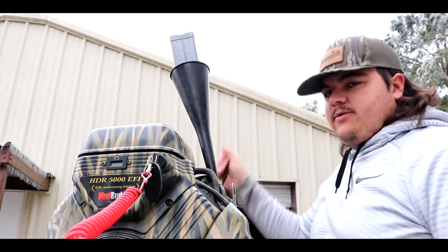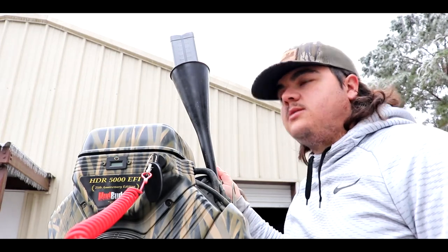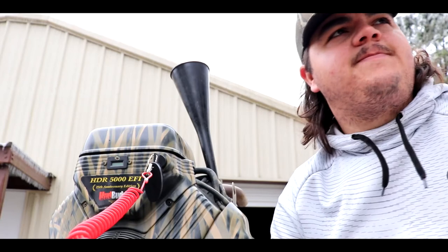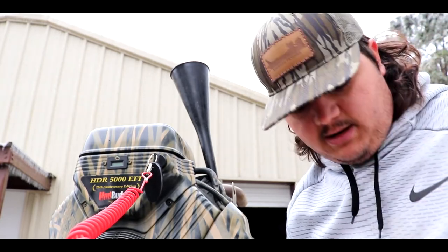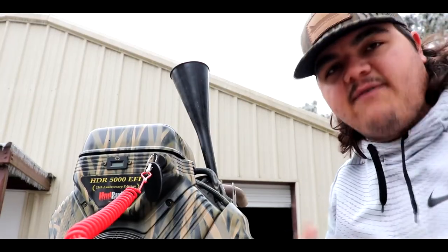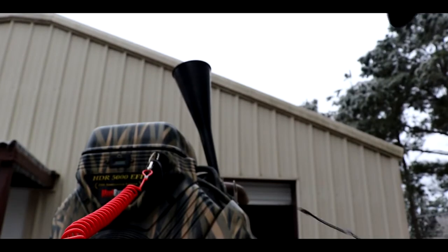All right, you can just check it with a dipstick, stick it in. This oil's gonna be really cold, so just give it a second to sink down. Take this one out, put the cap back on, be clean. God, it's cold as hell. I don't know what I was thinking coming out here. It's a 10W30, because, you know, Amsoil. So I'm going to pour a little bit in there, probably half a quart. Let it sink down and settle. I'm right under it, so I'm going to put a little bit more.